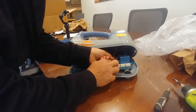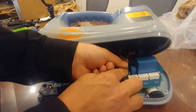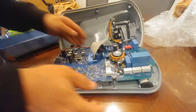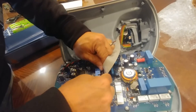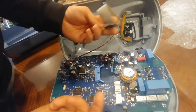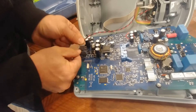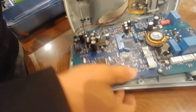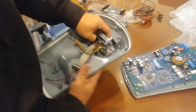You have to unplug each relay cable. Pull back on the lighter gray tab just a little bit and unplug the shortest one first. Then you can flip over the top. The second relay cable — pull out on the two blue arms and that releases it. The third one is just like the first: pull back on the light gray tab and that one will release.